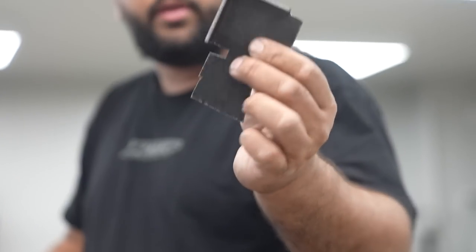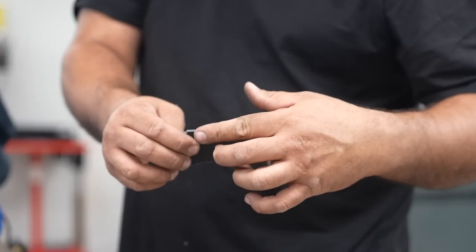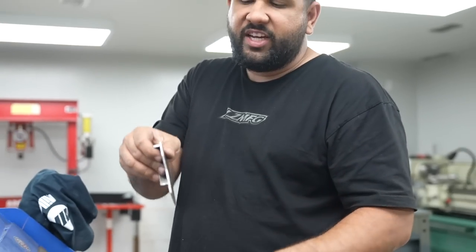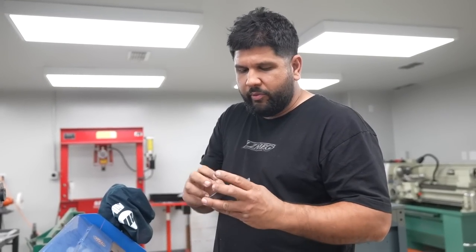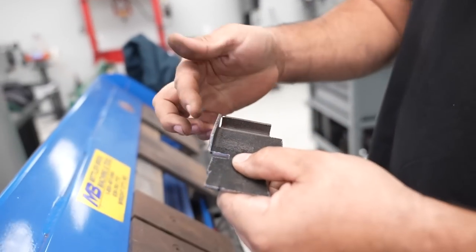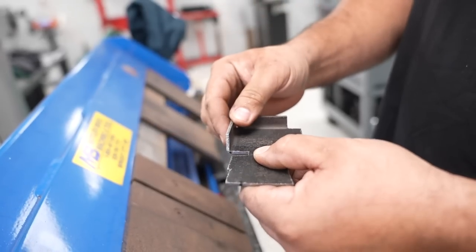I got two bends, I got one more. Remember, you can see here that I'll weld it out here, down here, along the side. Punch my holes for the nuts. I could tap it, enough threads there, but just in case, I'd rather put nuts in the back. And now I've got to make one more bend. I am trying to make this bend, right? It's gotta be pretty much the same direction as this one, 90 degrees.